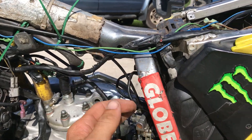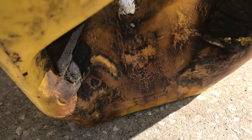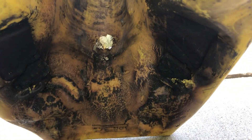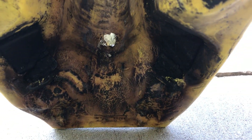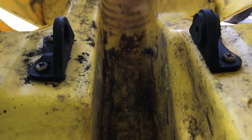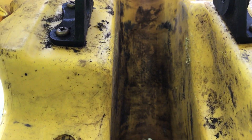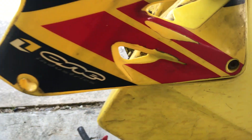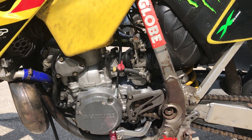These bars on the RM frame come basically straight down, and there are little tabs — they stick out like nipples — so you have to melt everything to be able to fit inward and then melt the inside of the tank. You probably pull it in like four inches compared to stock. You heat it up, push it on the tank, let it press down a little bit, then let it cool down because it'll harden to that shape. You just keep redoing it until you get the desired shape.